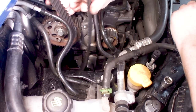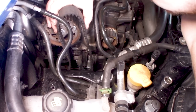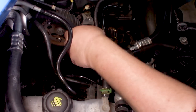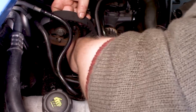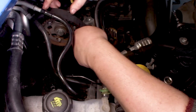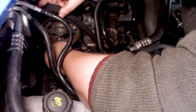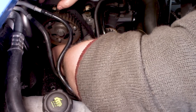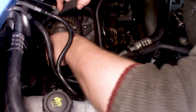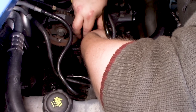So the first thing I do is just hook it on the bottom pulley. So I did put it on there, and then of course through the water pump, or a next step where you know it's secure, then just on the edge of the camshaft pulley, and then just stretch it